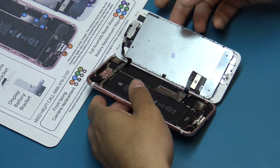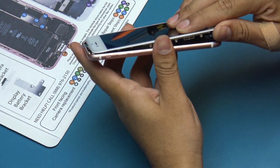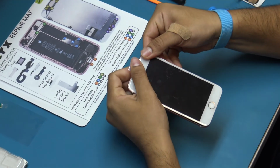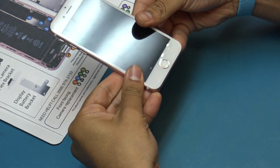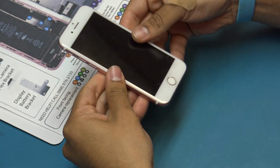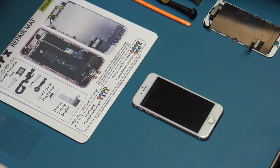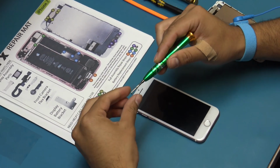Insert the top display assembly clips into the top of the frame by sliding into place. Use your thumbs to evenly press and clip the display into the frame. If you feel heavy resistance, do not use excessive force. Reopen the device and ensure that all components and plates were installed correctly. Insert the 2 pentalobe screws into the frame, securing the display assembly in place.